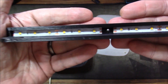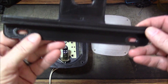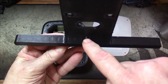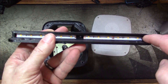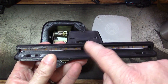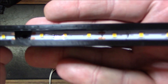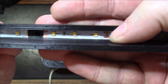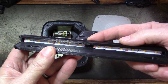I did it in two pieces for a reason — I was trying to figure out where to bring the wires in. I thought the best place is directly from the bottom of the taillight housing, in through a hole, and in here. But then I'd have to run the wires all the way to one end. I didn't leave enough room for that, so I like the idea of the wires in the middle. You can cut the LED strip every place you see a little line with a scissors pictogram, right across those contacts. So I've got six LEDs per side and I'm going to bring the wires down through the middle.